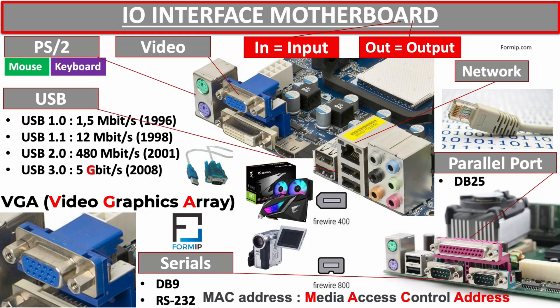Let's move on to the sound card. Just like integrated video, if the motherboard is equipped with an audio output, it's called an integrated sound card. This is what processes sound through the computer's speakers. A basic sound card has at least one port for speakers, often represented in green, and a port for the microphone, recognized by the pink port. More sophisticated sound cards will have additional ports — for example, for bass, surround sound, and other digital audio equipment.